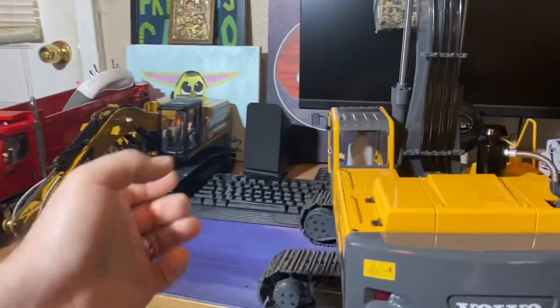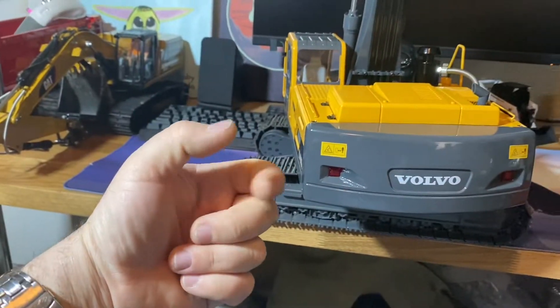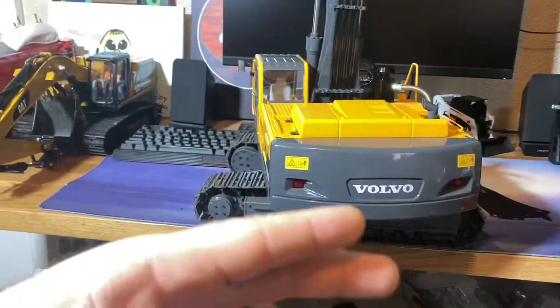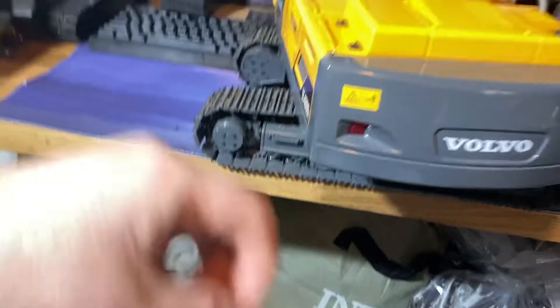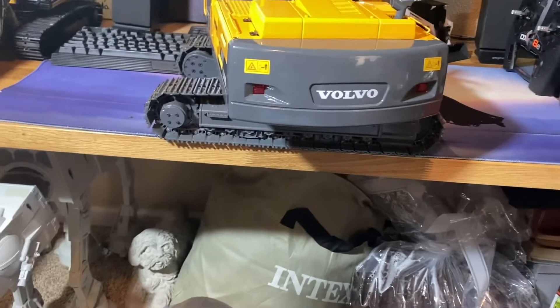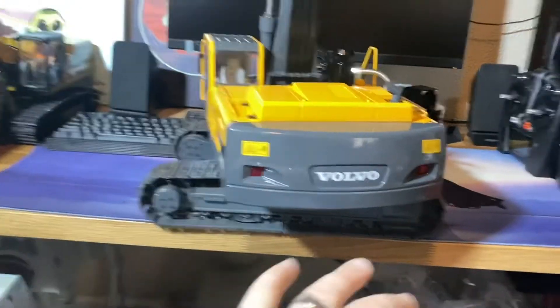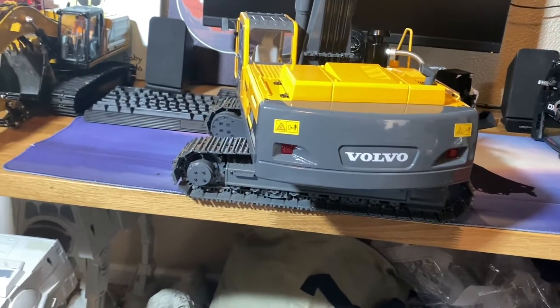Use cans of dust-off in the tight areas, and get one of those little air blower things people use to clean PCs — just blow this stuff off, get in there with brushes. Not wire brushes. This is powder coat, so it should be a little tougher. I thought about cleaning it really good gently and then clear coating a lot of this stuff — a lot of folks do that for protection purposes.